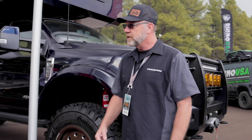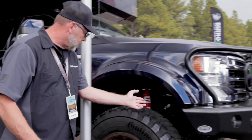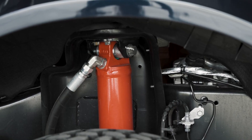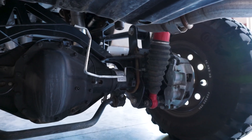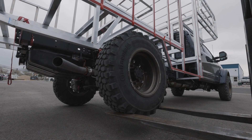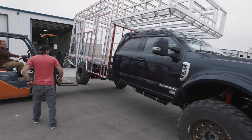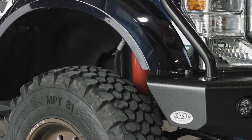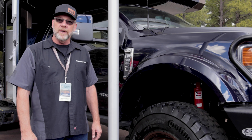If we'd like to, we'll step around here, and inside the wheel well we can see a red strut. Liquid Spring is a compressible liquid suspension. I know — compressible liquids, yes. Silicone-based fluid, 6% compressibility. So with that, we're able to achieve spring rates, and now we're going to couple that with a couple other components, and we can vary that spring rate.